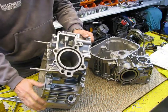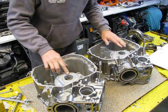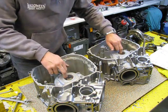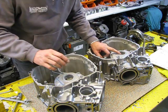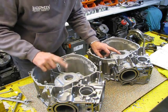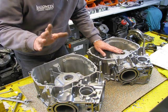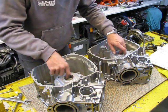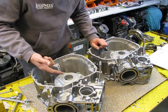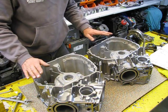Let me explain a little bit more. Those 2 engines are going to be built. Even a 3rd engine I'm working on, it's standing there beside me. I have to take it apart. When I sandblast, you will sandblast this surface too. Don't worry about that. The bearing is still inside. But I prefer not to sandblast it. How strange it sounds when I say this, but this bearing is very strong. If you don't sandblast them, you only have to clean them out. That we do later on. I never protect them when sandblasting. Not directly on it, but if you don't hit them directly with sand, it's not a big deal or a problem.